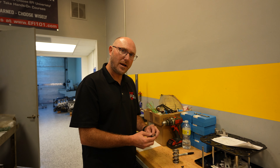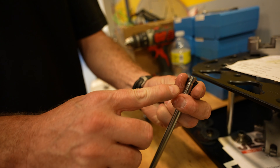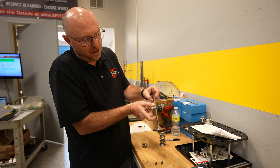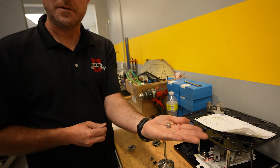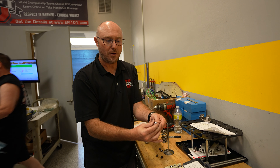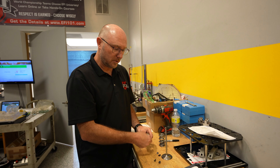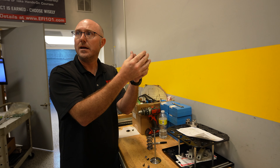In order for all that to work right, we also have to be aware of the way that the lock system works. We have these — they're called locks. They have a groove in them that matches the groove in the valve stem, and you can see that the locks are tapered. So there's a cone shape inside my retainer that matches the cone shape of my lock. That spring is now pushing force up, trying to pull this apart, and it can't do it. I have in my hand a gauge ball that's 9/16ths of an inch in diameter. That ball is bigger than the hole at the bottom of my retainer but smaller than the hole at the top. So if I drop the ball in the retainer, it doesn't go all the way in, but now I can come over to my gauge and measure from the top of the retainer to the top of the ball and get a number.